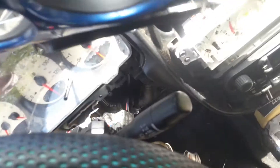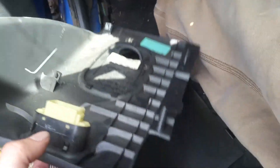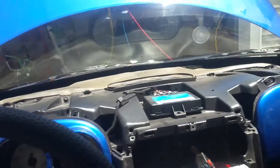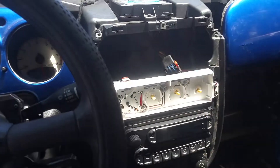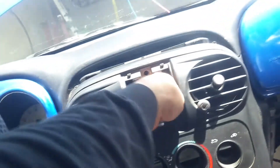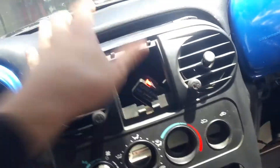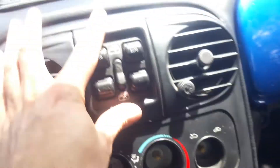I've just put the bulbs back in this trim piece that goes on the dash and we're setting that back into place. Getting ready to stick the side panel back on — remember there's a connector right there for the mirrors that goes into that. Putting the two screws in for that panel. Getting ready to put this dash piece up here — put it back in just like we took it out with the little prongs going in there. We've got the two screws back in for the dash. Now getting our bezel set back into place — make sure to get the little connector pulled back up for the window switches, put the screw in the center, tighten that down, connect the window switch, and snap it back into place.